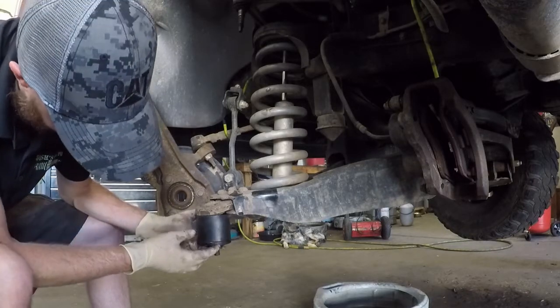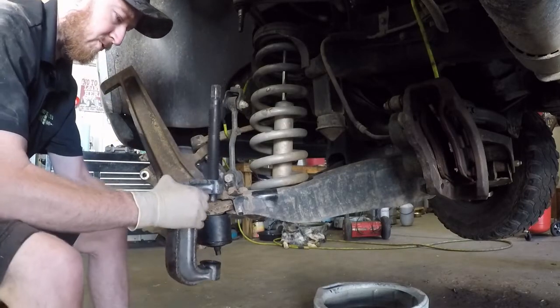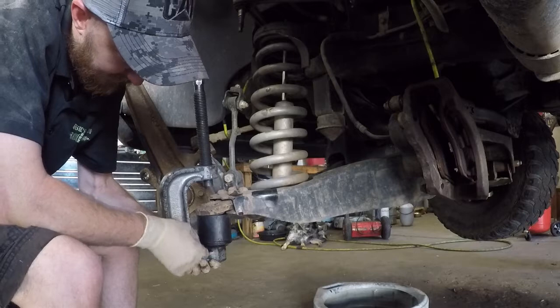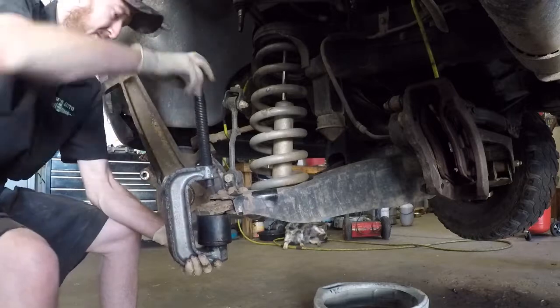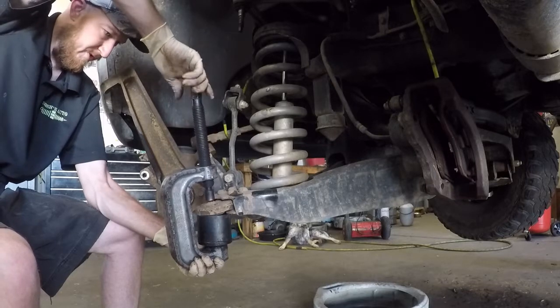A little lip you have to watch out for — you have to be to the outside of the lip that gives this tool enough room to press it down. I've already got my sizes picked out that I needed and got it opened up so that the ball joint can press down and come through this opening down here. I'll run this down until it pulls up tight on the top of the ball joint.